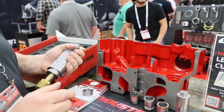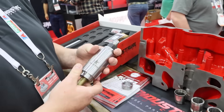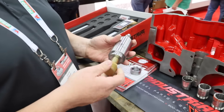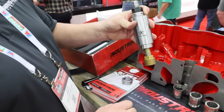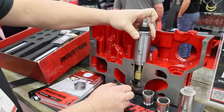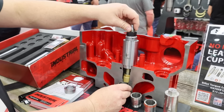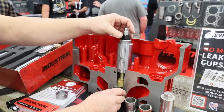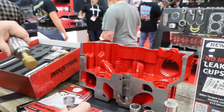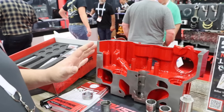Lubrication is your friend on this — definitely read the instructions on lubrication. You lube up the shaft, lube up the nut with a moly lube like ARP lube, and put a nice oil on the extractor as well. Thread the extractor in — it recesses in and sets into the tapped cup — just thread it in a few threads, then tighten the nut and it extracts your stock cup out of the hole. Go ahead and do that on all six so you have all the cups out.